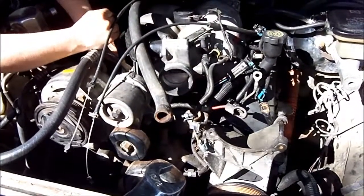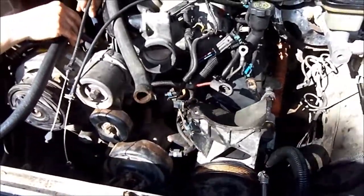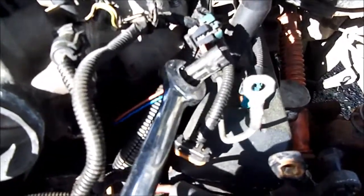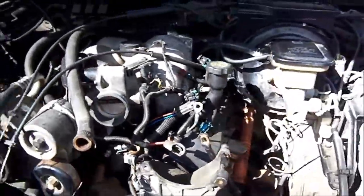For the most part GM does really good about one plug, one place — one doesn't plug into the other. But right over here, the injector harness coming out of the lower plenum, the intake manifold, will plug into this plug as well as this one. I believe it's this one because it's a two-plugger job, and so is this one.